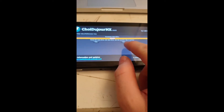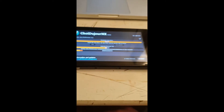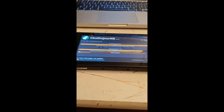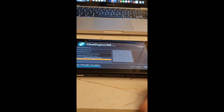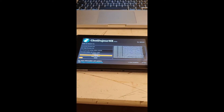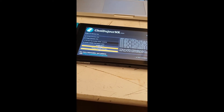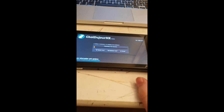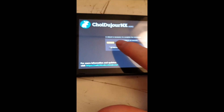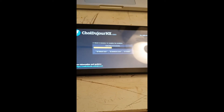Here you can choose if you want to use it with EXFAT support or just the regular. I'm going to go with the regular, and it's going to load all the files. You can select the firmware — it's going to load — and you can click start installation. When it's done, you can click reboot, then click reboot now. When you have booted into your Nintendo Switch unit again, it should be upgraded to 7.0.1.